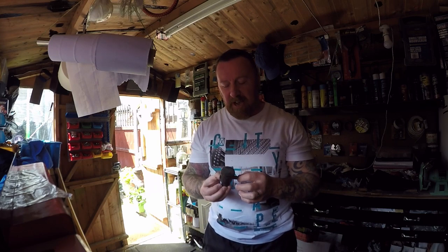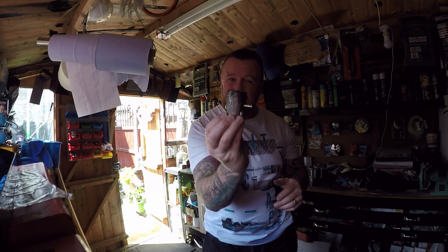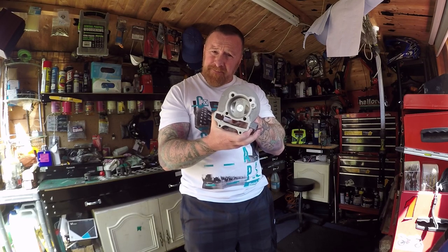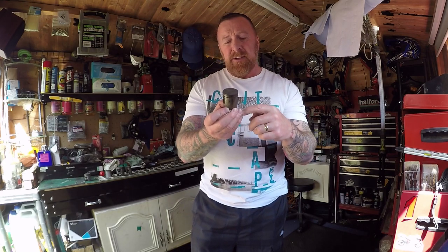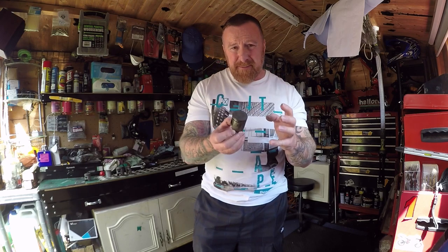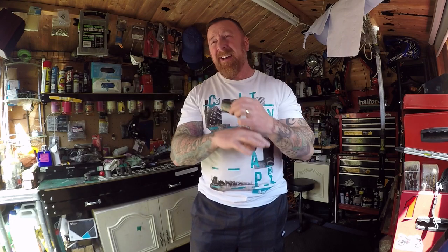So if it locks up or jams up and then frees up afterwards, don't think you're going to ride again happily, because it will get worse and worse. Because your bike is running with this scored piston - and I know this is new but it's an example - this is hammering up and down. If it's scoring the piston, and generally the piston is a different metal than the outside, you can imagine the scoring here and on the side of the actual outer wall as well. So it's going to be pretty messy. They're going to go up and down, and then you can get catastrophic failure where the piston just breaks apart and it wrecks everything.